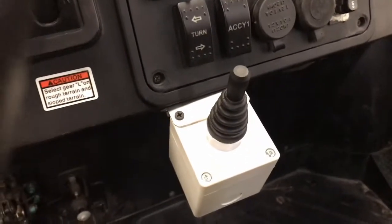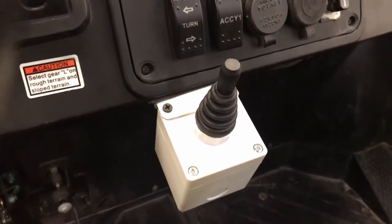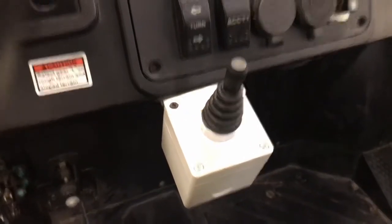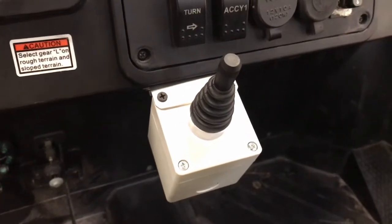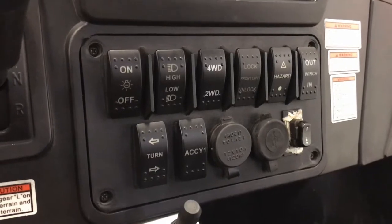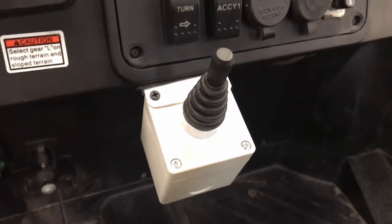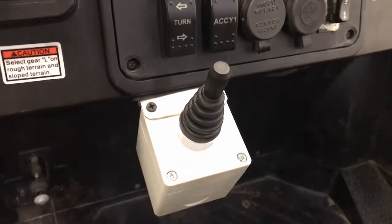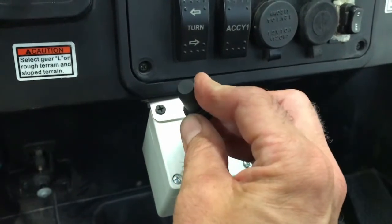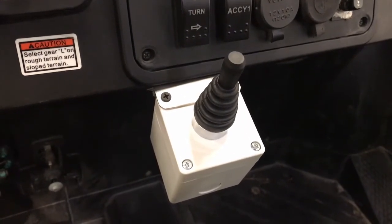This is the first machine where we did a joystick for UTVs. It's been a bit of a challenge since there are two switches — the switch that comes with the machine for the machine winch, and then we add a switch for the Ground Force winch as well. That was cumbersome, and issues with installing the Ground Force switch into this panel made us think of a better solution. With the joystick, we have up and down for the lift frame and up and down for the bucket, so all functions are in one joystick — which is a very good solution.